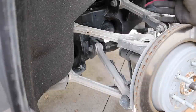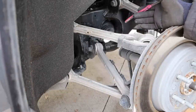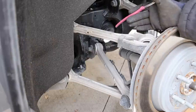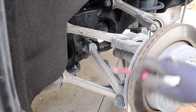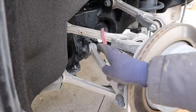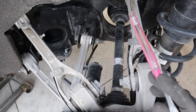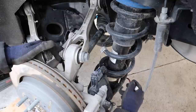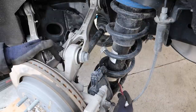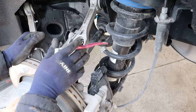Taking a look at the rear suspension, you can see it has a multi-link design, which is a lot better for ride quality, this being more of a passenger vehicle, as opposed to the solid axle that the Ram 1500 this is based on uses. At the front here you can see all four links — they're all made of aluminum — and they all connect to an aluminum knuckle as well as directly to the steel tubular frame. Finally at the back here you can see this rear link which is made of steel, with the coil-over suspension on it. Of course there is an option to have air springs at the back as well.